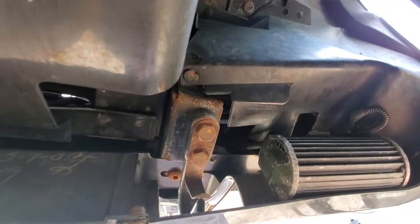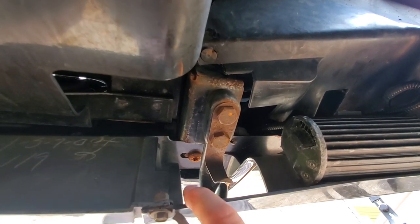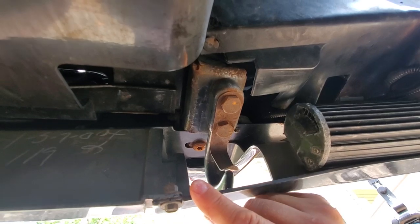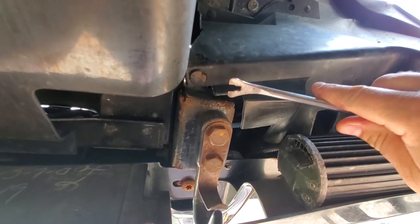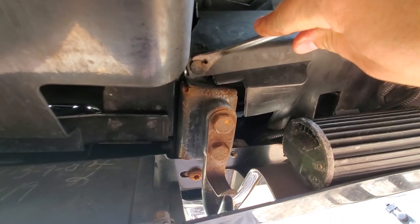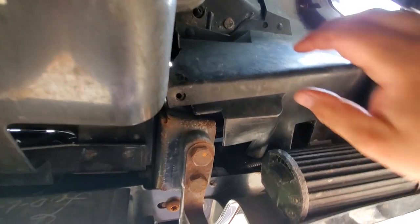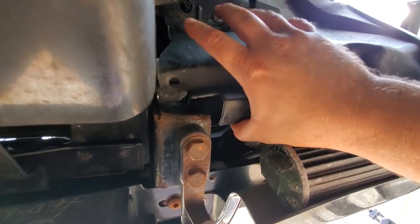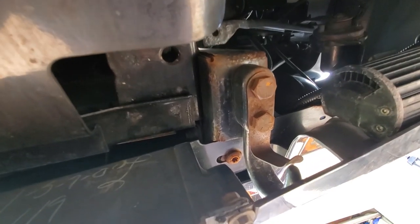All right, once you're under the Jeep, your bumper end is connected to the center portion of the bumper trim with a fastener here. I don't know if yours is like mine, I think that's custom 10mm. You're also going to have to take off the wheel well trim, so I'm going to pop that off. Maybe you guys still have your trim, maybe you don't. But behind the wheel well trim, there's some more fasteners.